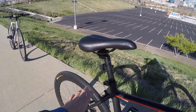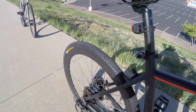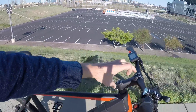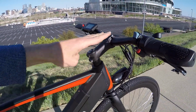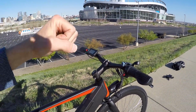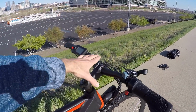Again, just the higher pressure on those tires combined with thick 12-gauge spokes and the deep dish rims, it's sturdy, but it's just not as comfortable. And the stem is a little bit longer. It's like 100 millimeters. It's got a couple spacers, and it's in the up position right now. You could flip that and lower it to get even more aggressive, kind of like a road bike if you wanted to. But I've got it in that upright position here because I want the comfort.